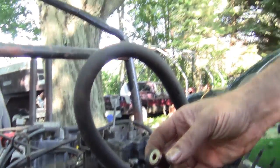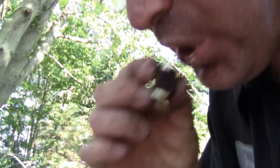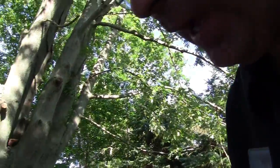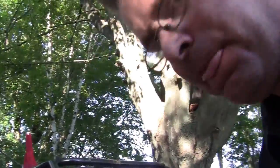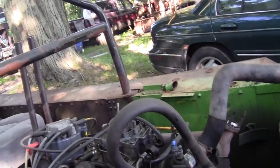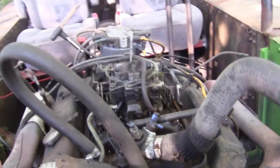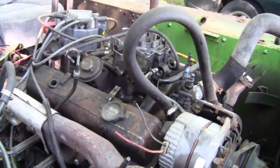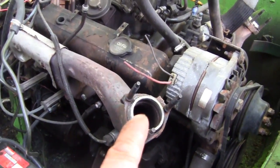This is how I used to check them — you can see I can't blow through it. So the fuel filter is plugged. I'm gonna get one of them at work, but to get this tank back where it belongs so I can start working on it, I'm gonna put that back together with no fuel filter and it should be okay. I'll either put one of the cartridge-style ones back in or put an inline one.